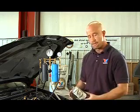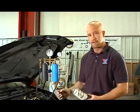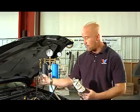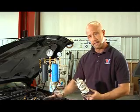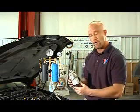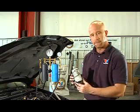So we have designed different types of chemistry for different components of the fuel and air induction system and different points of introduction of that chemical into the system. For example, the fuel rail cleaner is injected through the fuel rail, so it takes care of everything from the fuel rail down through the injectors, the intake valve, and then into the combustion chamber. Then we go a little farther out into the air system, which is introduced through the throttle body through a mister that is highly atomized, so it takes care of the throttle body, the intake manifold, and the plenum.